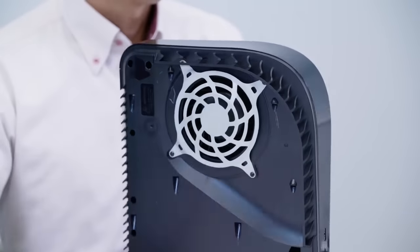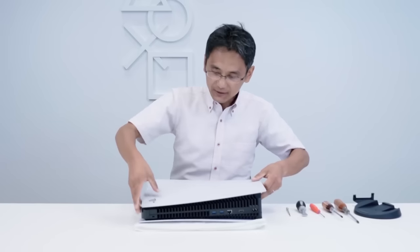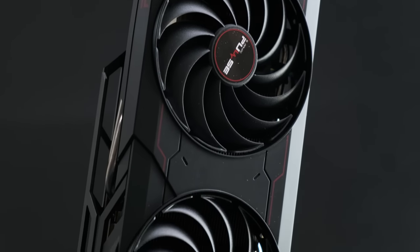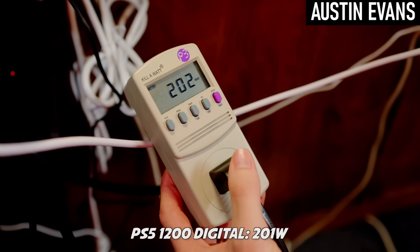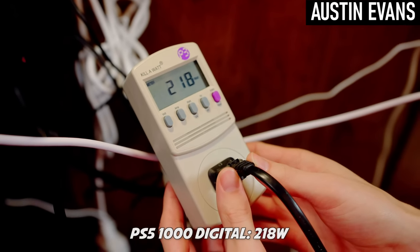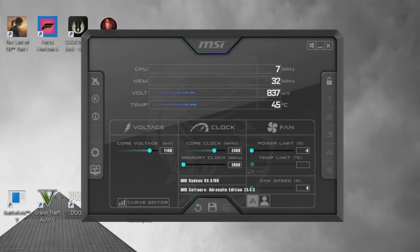For this challenge, I'm not focusing on literally building a PlayStation replica, but more of an homage, so rather than focusing on downclocking the RX 6700 to a specific frequency, I'm instead working to a particular power envelope. According to Austin Evans, the various models of PS5 consume between 200 and 230 watts of power, so I'm going to play with voltage and power limits to try and keep the full consumption of the PC to about that same amount. More on that later.